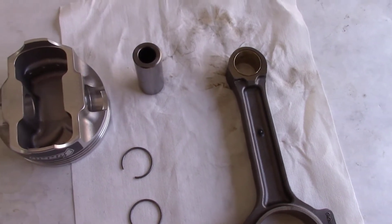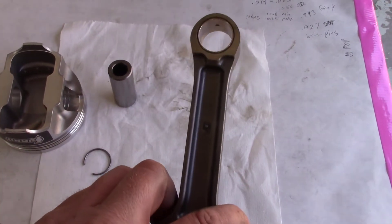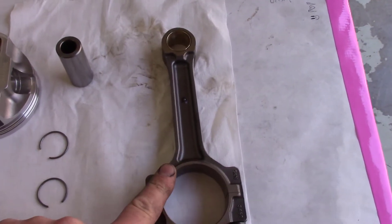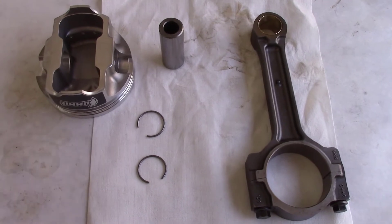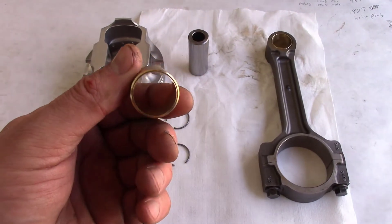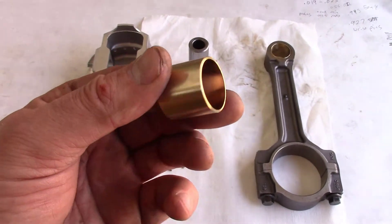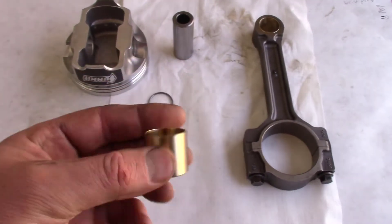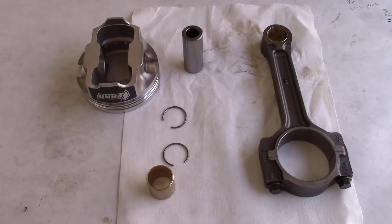Now I can use the 0.927 high-performance forged pistons from Summit. While my rods were at the shop I not only had them cleaned but also shot-peened — that both cleaned them up and increased the external surface structure strength of these Gen 4 rods. The bronze bushings were made at Oliver Rods up in northern Michigan. If you need a set I've got an extra set or I can give you the order number so you can order your own — hit me up.